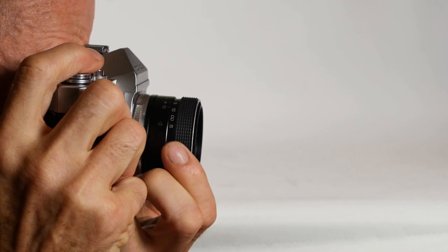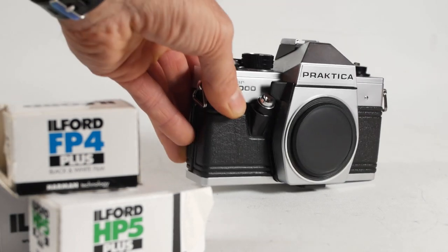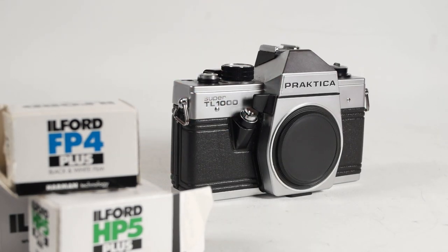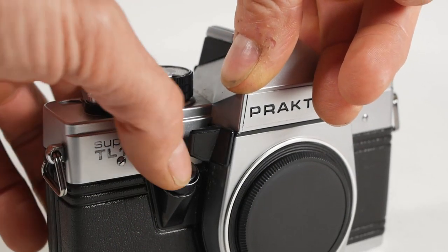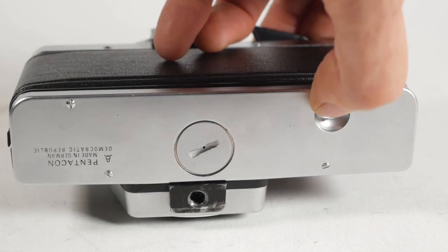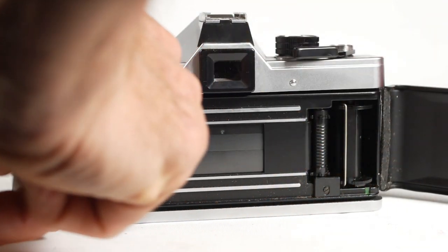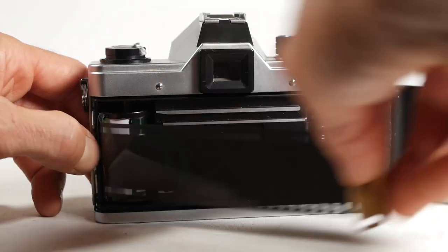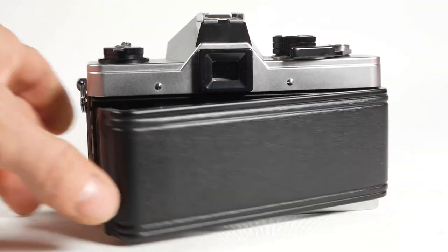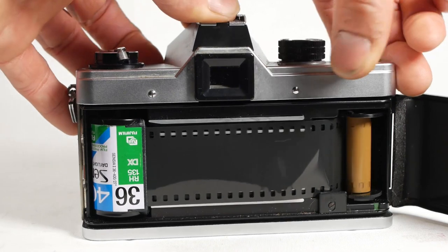Just playing with the camera it felt right in my hands, so the next thing was to put a roll of film in it. I'd got plenty of black and white in stock, but along with the spare parts IC1 was this Practica Super TL-1000, which was jammed solid — you couldn't advance the film, release the shutter, or even lift the rewind lever to open the back of the camera. Simply pressing the drive release button on the bottom freed everything up, and upon inspection, someone had installed a film with the canister exit pointing upwards rather than in the direction of film travel, then closed the back and tugged on the film advancing lever, putting so much tension on the film that it even stopped the rewind lever from pulling out. The loaded film should of course have looked something like this.